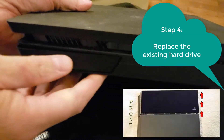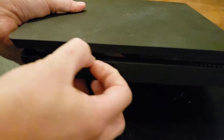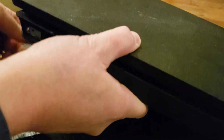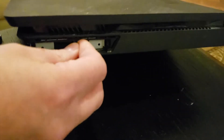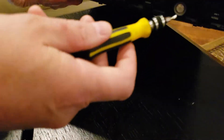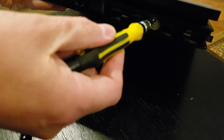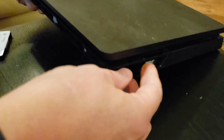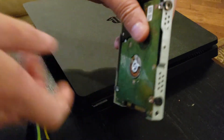With the Slim it's particularly easy — just take your nail or a knife and pop the little back cover off. As you can see it's just a piece of plastic. Inside there's a pull tab for the drive bracket, and there's a Phillips head screw you need to remove — you'll need smaller tools than the typical household screwdriver. Unscrew it and pop the drive bracket out.